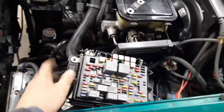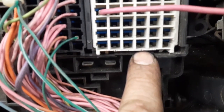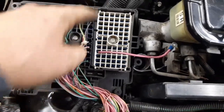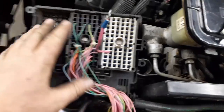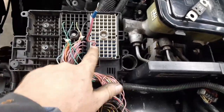There's only one modification I made, and that's on this connector. The rows are A, B, C, D, E, and F, and the columns are numbered — they're super tiny. This is position A9. You connect this wire to your key-on ignition, and that will power the fuse block — it tells everything to turn on. There's a relay here, and this power tells all the other relays to turn on, which gives power to everything. So connect that wire, and the system works.